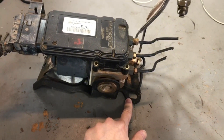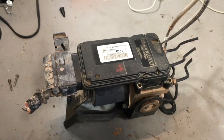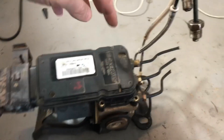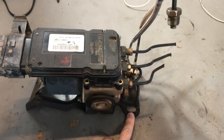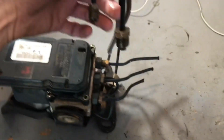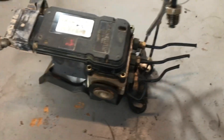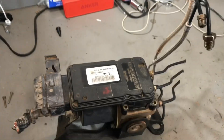Basically, the motor is held in with a bracket with three bolts — one in the front, two in the rear — 13 millimeter or maybe half inch bolts. This whole era of Ford is always super confusing on what's SAE and what's metric, but a 13 or a half inch should get those out. Bring some extensions and you can get them from the top. This one I removed from the driver's side wheel well using a ratcheting box wrench. Then you're going to have two brake lines that connect to the master cylinder and all three brake lines on the back. I just cut them with a big pair of dykes rather than sit there in the junkyard trying to unscrew those fittings. Then you'll obviously have to disconnect the module from its main harness, and then the whole thing can be pulled out of the engine bay.